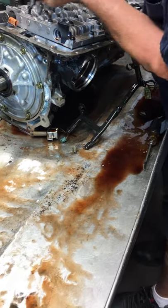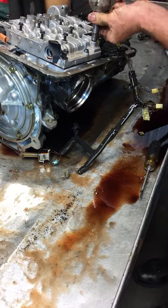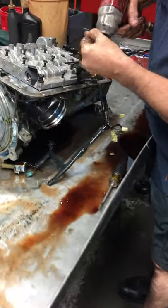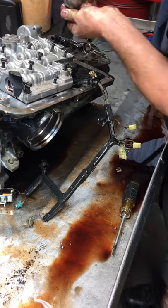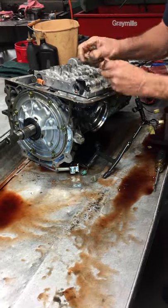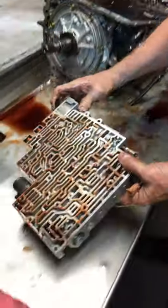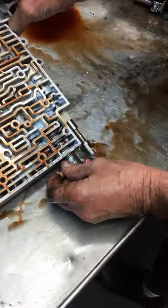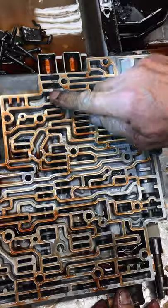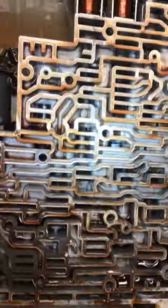What's crazy is people think 'I have a second gear, I have a third gear' — they're thinking about physical gears in a transmission. Well, in an automatic there's physically no such thing. All we have is clutches, bands, seals, bushings, and a valve body with a lot of shift valves. All these valves do different things when the computer tells these solenoids to move, which strokes these valves and causes the transmission to do different things. These are very sophisticated.